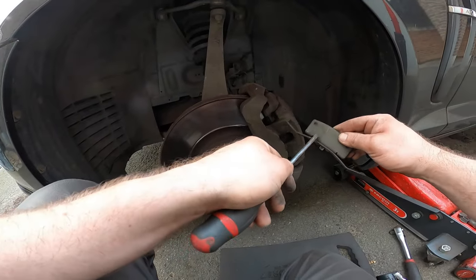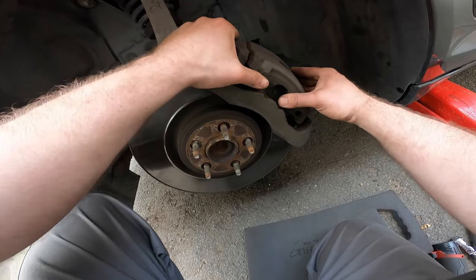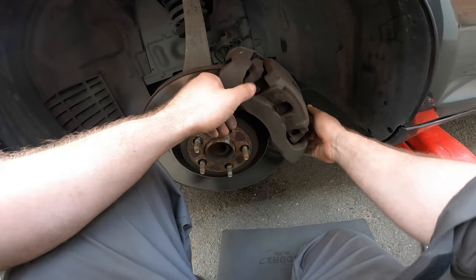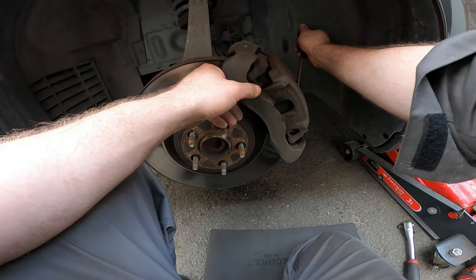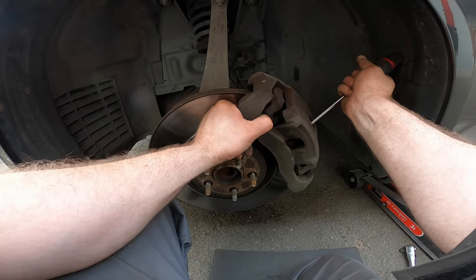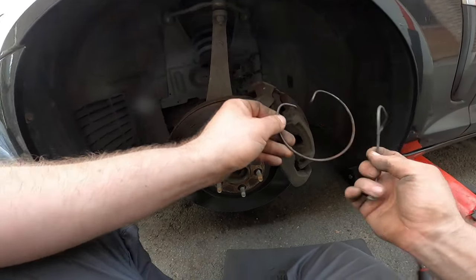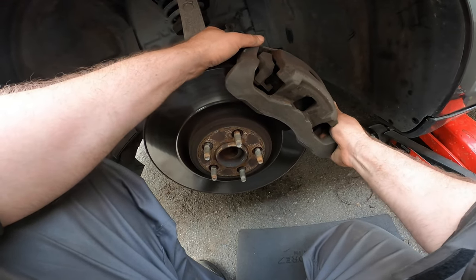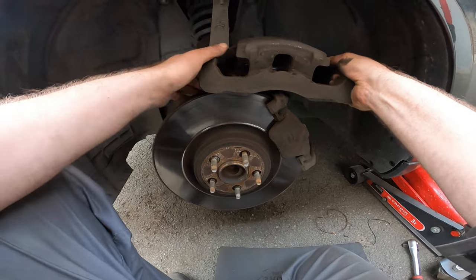So, just pry underneath this one, and there we go, should be able to lift it out. Still a bit tight, so let's try to move the piston a little bit, yep, perfect. And before we take it off, we need to hang it on the spring. So let's get our tool. Hangers, leftover stuff. Oh, need to lift it out of the clamp. Alright.